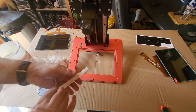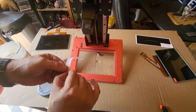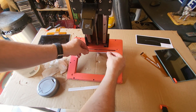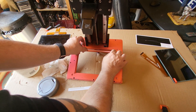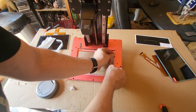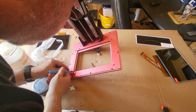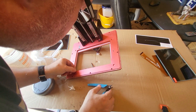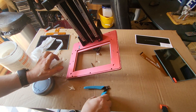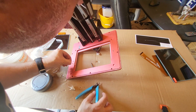I gave it a clean with an IPA cloth just to keep it nice and clean. Then I took these double-sided white sticky bits of tape - these are to hold the new screen in. Rip it off and put them down across the long edges on the horizontal and across the vertical. I thought it would be a nightmare to get the other side of the tape off, but it was really easy in the end. Stick them on, then take something sharp like cutters, lift the corner and pull. The bottom section stays on - it's a transparent double-sided sticky tape. And once I'd done the one, the others were really easy. It's imperative you do this because it's what's going to hold the screen in place since there are no screws.